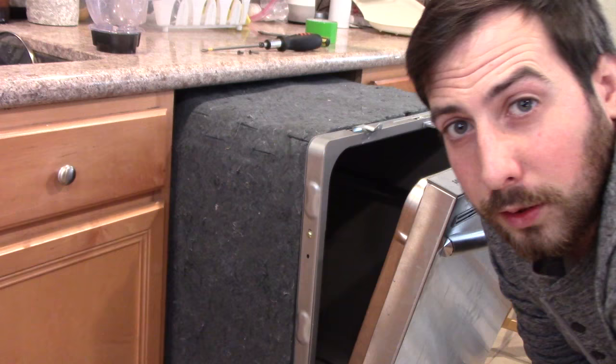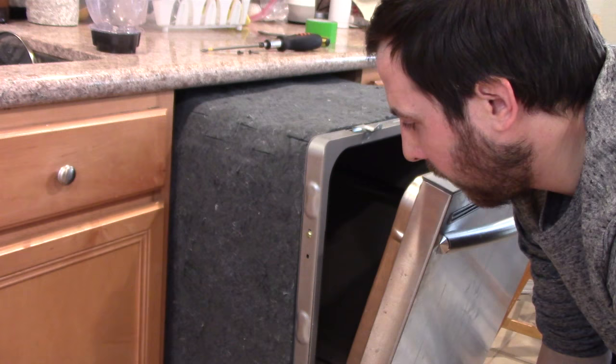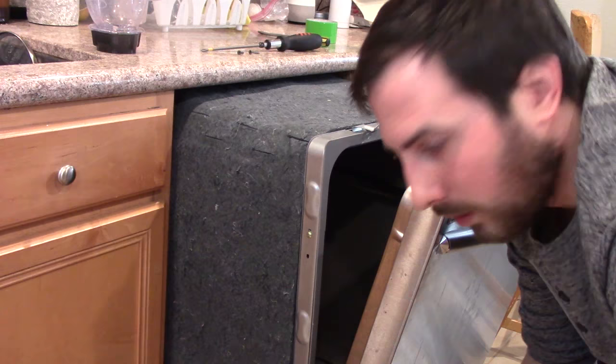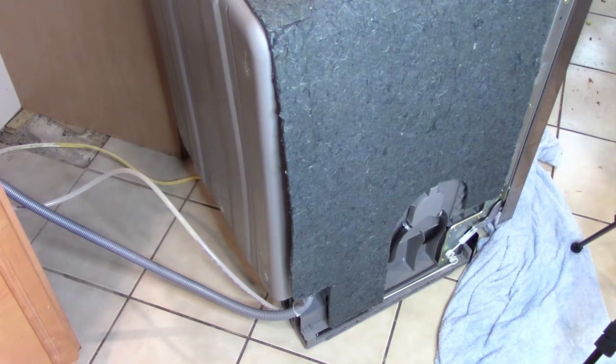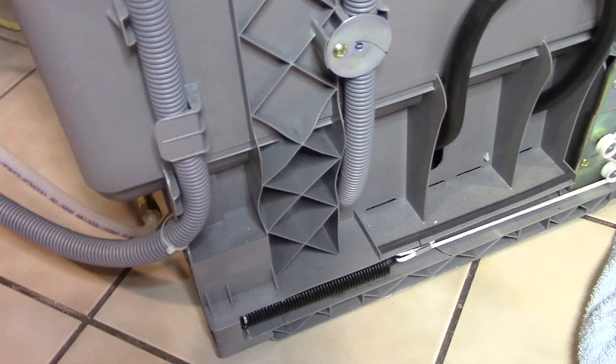We've got motion. There is a possibility where if I take this thing out, flip it on its side, a bunch of water spills out everywhere and makes a big mess. So I'll probably grab some towels and lay them out around, with my trusty mop just in case. Before I actually flip it over, I'm going to take a look at the hosing and tubing to see if there's any actual water leaking out. This tubing right here feeds into the dishwasher and that is where the water is supposed to drain out. I don't see any sort of water pooling, and the tubing itself feels dry.